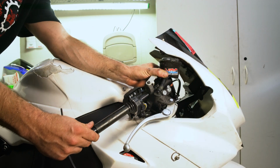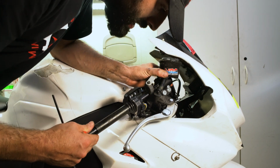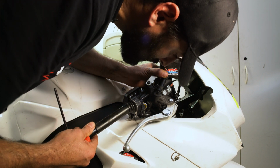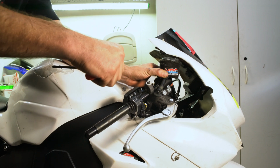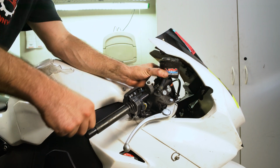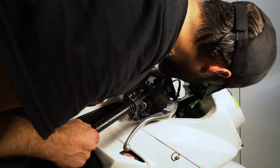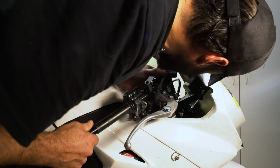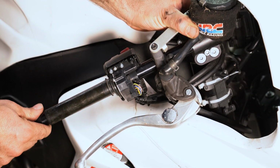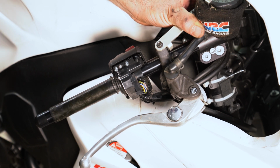All right. I'm going to set my hole a little bit further down than it was last time, because I was having a little bit of issue reaching the stop when you go wide open throttle and hit the stop. So I want it a little bit farther this way so that I can hit that wide open throttle earlier. And I think that'll help me out too on the straights, because on the straights you want to hit wide open throttle. It really helps you stay consistent. You go all the way to wide open throttle and you're hard on the brakes before the next turn. If you're not at wide open throttle, you don't know how much brake to give it.